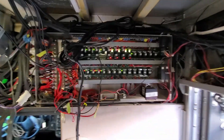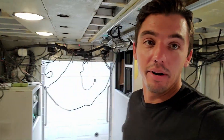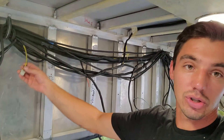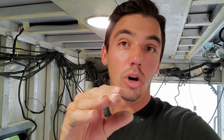I'm going to trace everything, mainly because we're not going to be using too much of this panel. I don't actually have any wiring diagrams to go off of, so I can kind of trace and diagnose roughly where I think things are. None of the fuses or relays are actually labeled, so I'll pull the wire loom off, trace back what I need, and start from the tails — eliminating everything that wasn't being used.